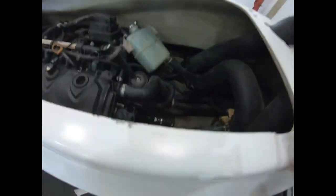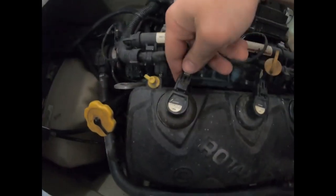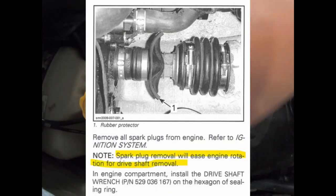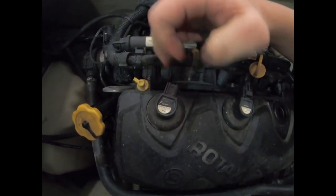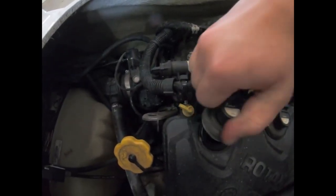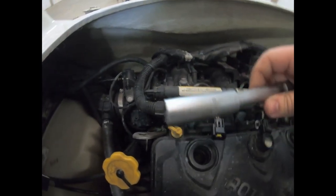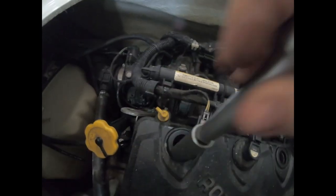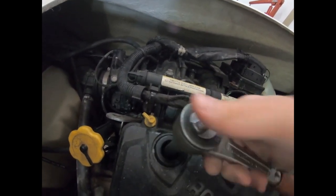To remove the threaded shaft, according to the Sea-Doo service manual, first of all we have to remove the spark plugs. To remove the spark plugs we can either just pull the coil out, or you can unplug the coil and pull it out, which is a little easier. Then all you have to do is pull the coil out — it's going to get a little bit stuck with the spark plug, but just pull it out. With the coils out, you are going to need a 16mm spark plug socket to remove the spark plugs.